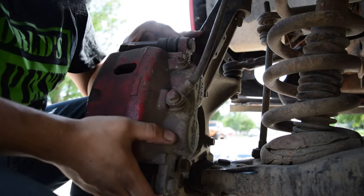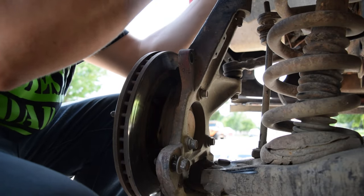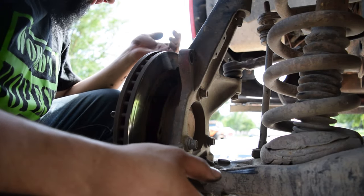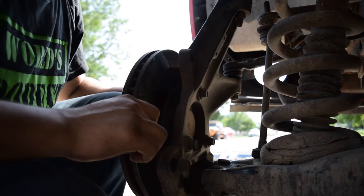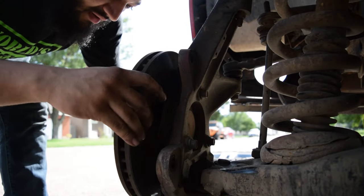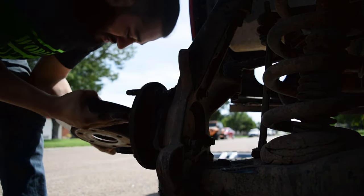Now, you never want to have your brake caliper getting yanked by the hose. So, being the fine gentleman that I am, we're gonna put her there. I don't even think this brake rotor is the correct rotor, to be honest with you, because it's not wearing the brake pads evenly. But that's another story for another time. So, like I said, your brake rotor should indeed just come off of this bad boy. Oh yeah, there's like trash all wrapped in it too. That's cool.